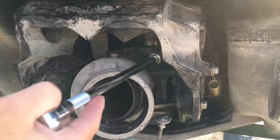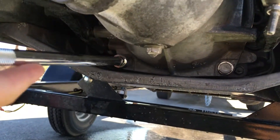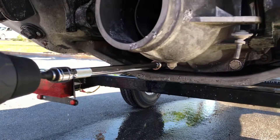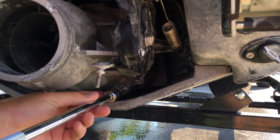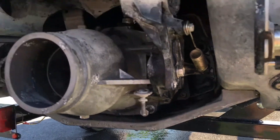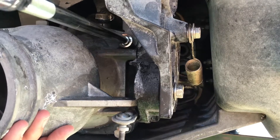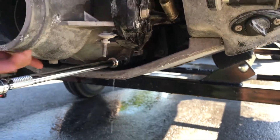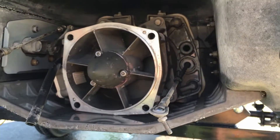Now you're going to lift the reverse gate, which will give you access to the bolt on top of the pump. You need four bolts all the way around — these are all 14 millimeter. Pull these out and there's your full steering kit that has come off. Now you have access to your pump.